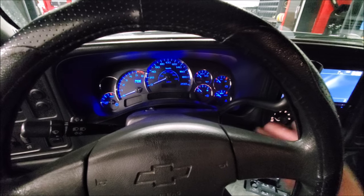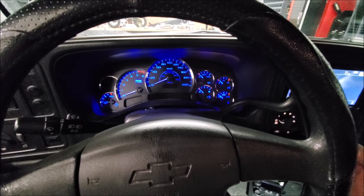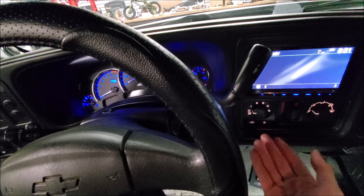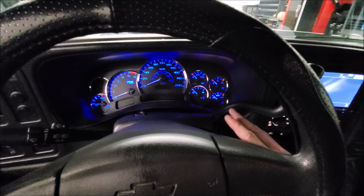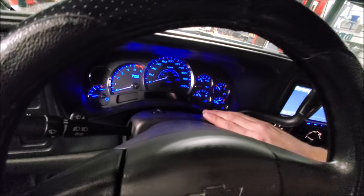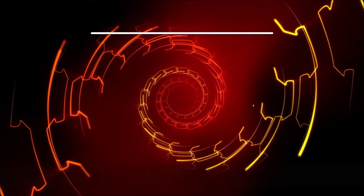So there you guys have it. The culprit's probably going to be a broken wire nine times out of ten. It is possible you're going to have a faulty switch, so always do a continuity test if the wire checks out just fine. Now, if you were looking to change out this column, now's the time if you want to buy something new — you can put in a Denali one or an Escalade one if you want. Also, when you're taking apart these GM panels, warm them up if it's cold out — even better at room temperature, because they're a little dried out and might crack. There is also a high possibility when you put these covers back on, you might have a slight gap. They're very hard to put back on and have everything aligned. Hopefully that helps you guys out — I'll see you next time.